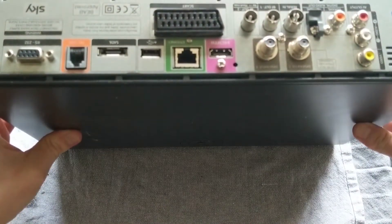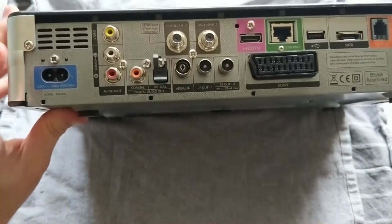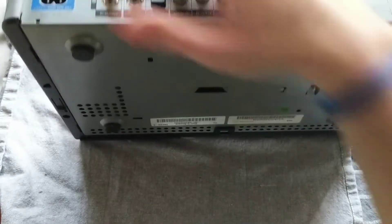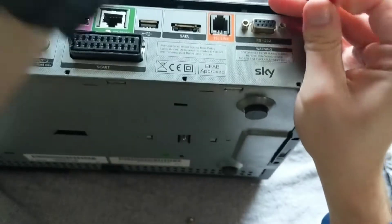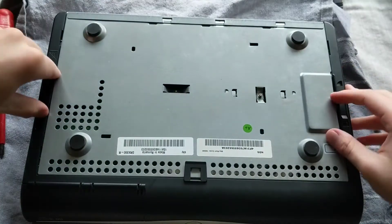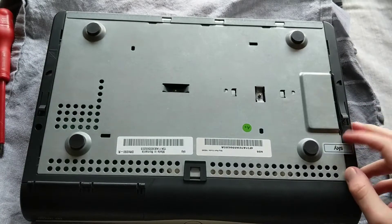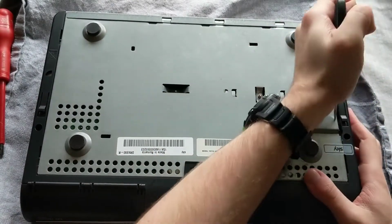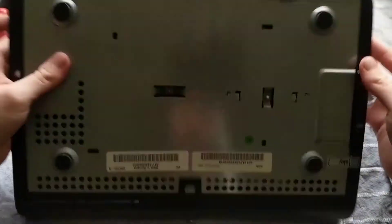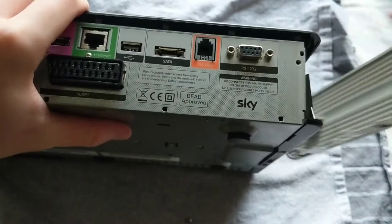These things are made quite unintuitively to take apart, we'll do our best. So I'm going to take apart these two screws here. And then what we can do is pull up these clips that are on the bottom, get rid of this warranty sticker - I don't think we'll be needing that anymore. And then with the clips pulled up we can slide these silver panels outwards.